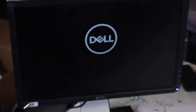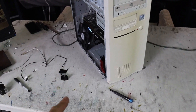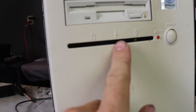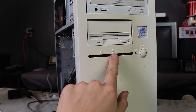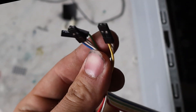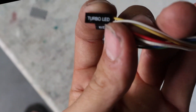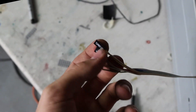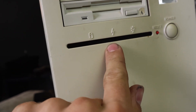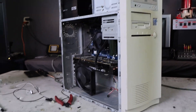The system is posting - success! The original Dell LED had a feature where it would go orange if there was something wrong, and I've been thinking about what to do with the turbo LED. I think that's a perfect thing to make it do - the orange light to indicate problems. My theory was to take the two power LED wires and connect them to the turbo LED line with swapped polarity so one is one way and one is backwards. It should go orange for a second and then switch to green - and that totally worked!